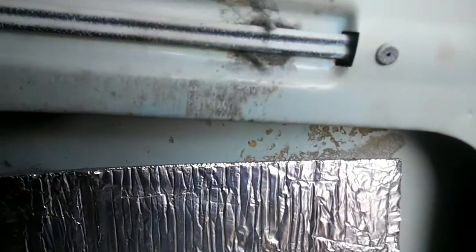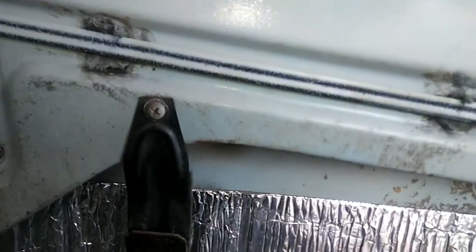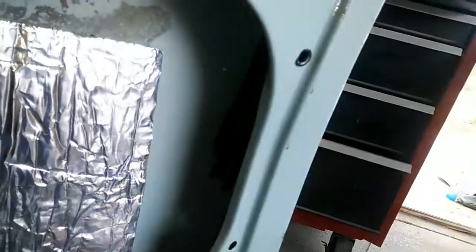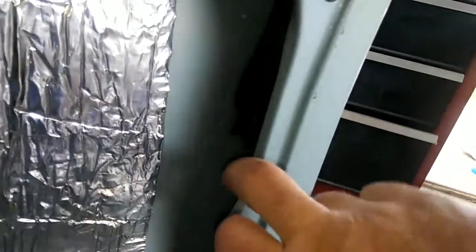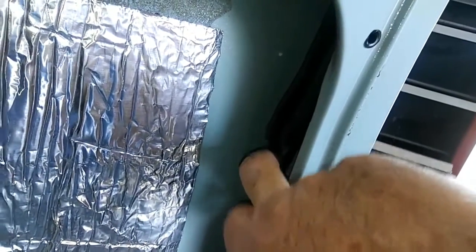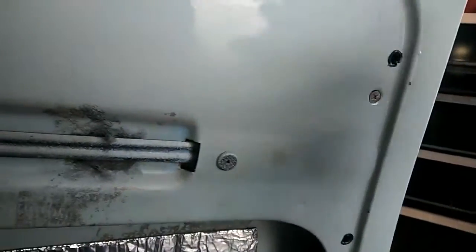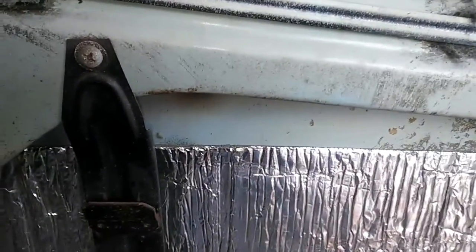Take it down, take the thing off. Sometimes you have to take the glass out, which means you've got to take the window regulator off. In my case, there's a little hook that goes up in there - maybe my window won't work right because that's not perfect, and if it isn't perfect usually something doesn't work right in the VW. I can just slide it out once I take this bolt off because the little clip on the top is broken, so normally you would have to take the window out to do it.